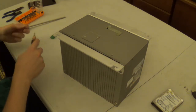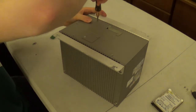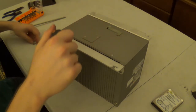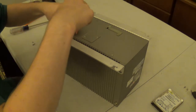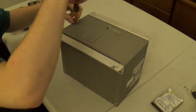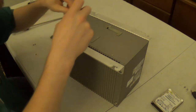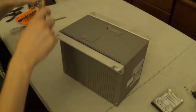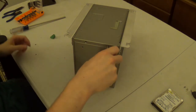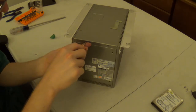Yeah, that's why I don't like those sockets, because with those sockets, it's unclear which way the battery should face. I think I've seen it go both ways, depending on how the system manufacturer wired the motherboard. But I imagine there's a reverse polarity protection diode installed on the motherboard that will happily put that battery right across the resistor and protect whatever happens to be downstream of it.